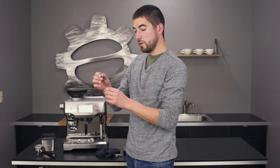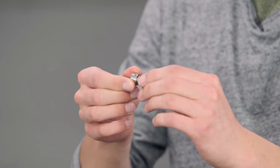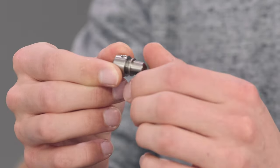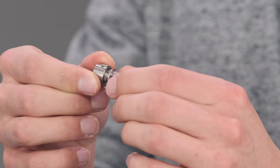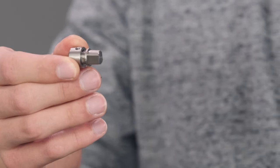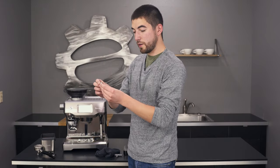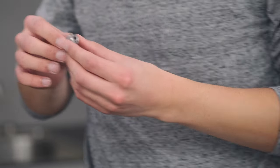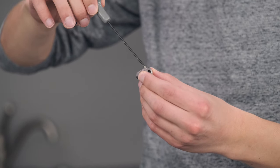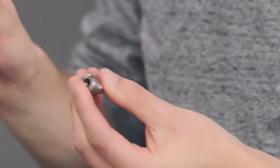The way to lower your dose of ground coffee is to take this square-ish connector and unscrew it - you're going to want a few threads showing. More threads showing is going to be less ground coffee in your portafilter because it's actually dropping the tamper fan lower. Therefore, the machine is sensing that where it is full is actually going to be lower, which will lower your ground coffee amount. I'm going to do four threads showing because I found that that is a good dose on this machine. Then place the set screw back in and use the two millimeter hex key to make sure it's nice and tight.